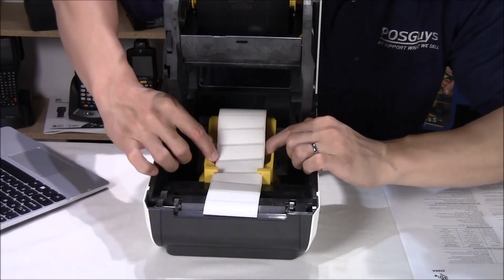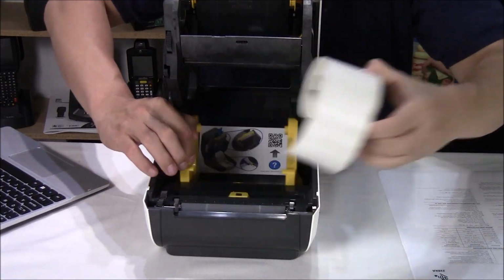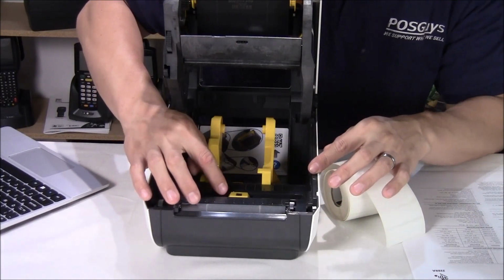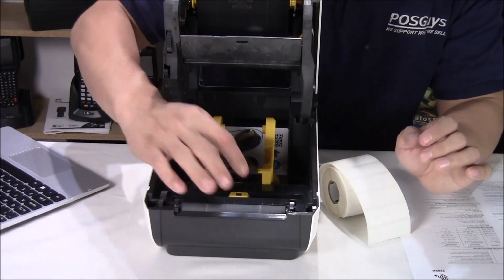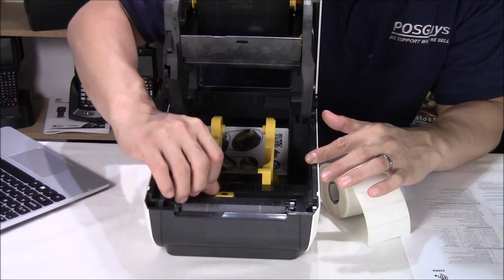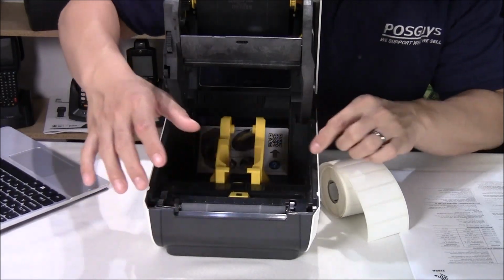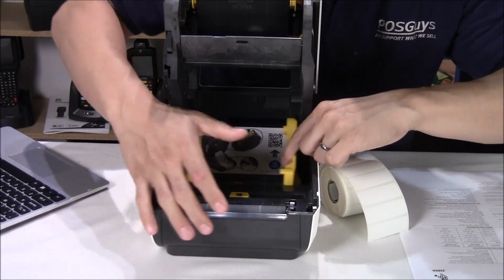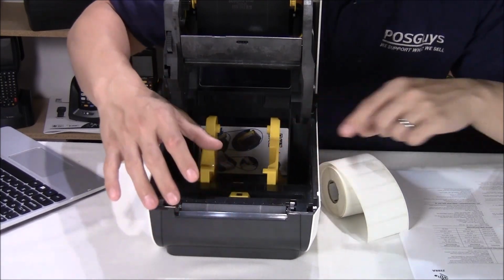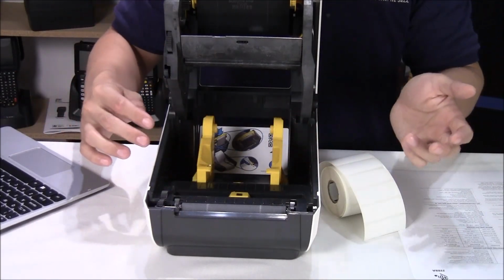Inside of it, you have your standard Zebra pinchers to hold your media in place. The eye on it is movable. So this is a nice change if you're printing offset media where the middle of the label might not be the widest part, or there's some kind of black mark only on the side. You can adjust it as such, and then you can also hold the 2 dividers at static widths. So if it pinches your media a little too much and you might get a jam, you can use this to keep the spacers out at their desired lengths.